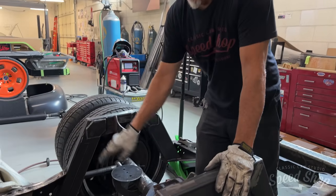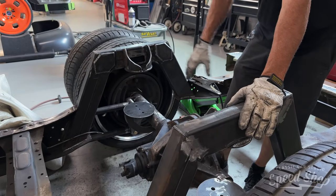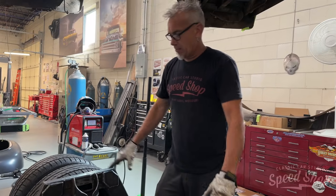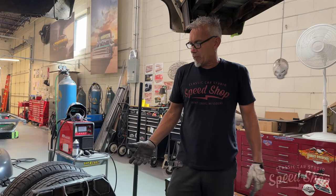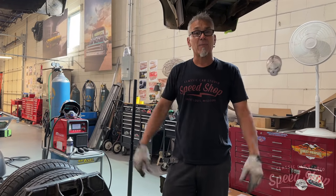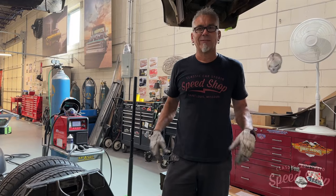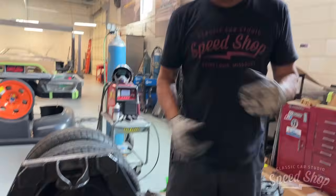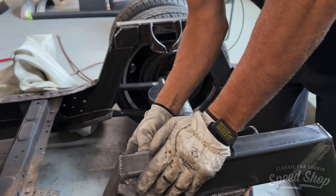I'm putting the bag under the frame so it pushes right in the center, not on any weld or anything. I'll still put the cross members in — the front one won't be much, the rear one will probably have my shocks mounted. I cut the cross member here to give more room — the drive shaft will come up through there. I can get rid of this altogether or put a little hump in it; basically the only thing I'm using it for now is an exhaust hanger. But I just put two more cross members in the frame right behind it, so that's handled. You don't need a big fancy shop or fancy tools — you've just got to have the patience to do it right.